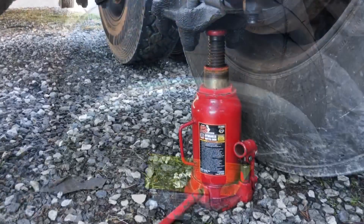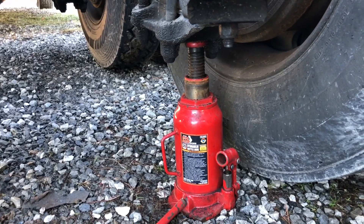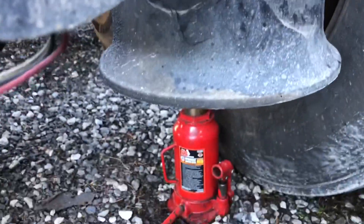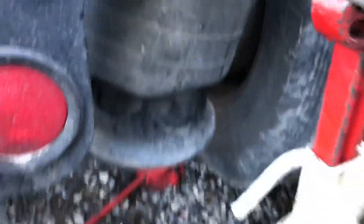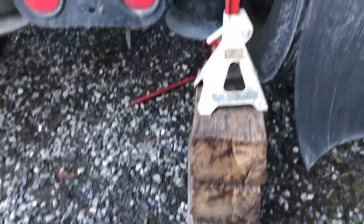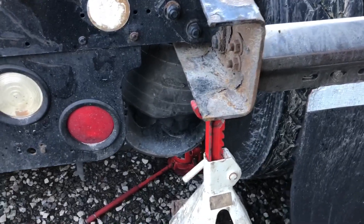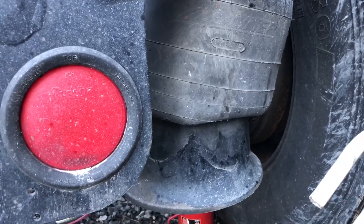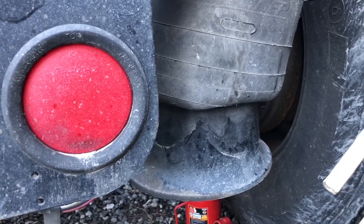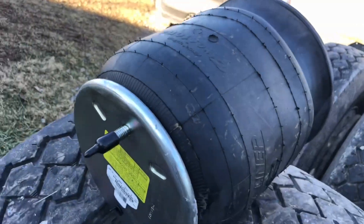What I did was I took my jack, raised my axle up, kept on jacking it up, and put together a cover block — a few blocks of wood — put a jack stand on it with my frame and then just lowered it down. The reason being is I'm going to have to take this old airbag out and when I go to put the new one in, it's solid, so I'm going to have to have the height.